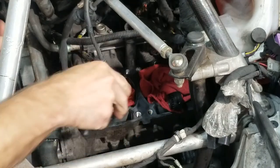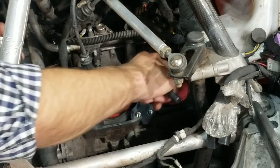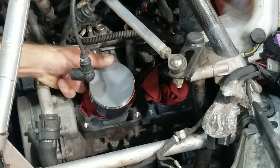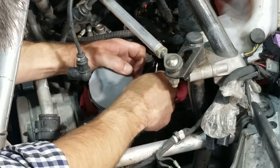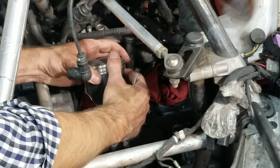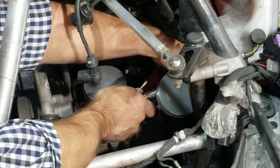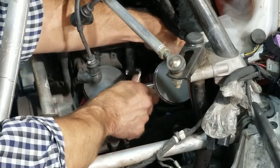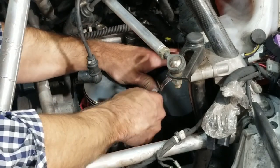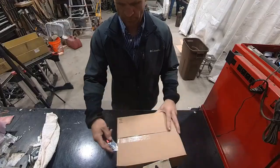A failure like this, though, is more likely to happen on one side or the other first. So if you don't get enough pressure to push your thumb off the top of the spark plug hole, that's your first indicator. Or if you can't quite tell if the compression between the two cylinders is different, you need to get out a compression gauge. And then if the difference between the two holes is sizable, then the odds are high that you've got an issue. I had 130. I had only about 90 on the failed side. In a way, it's remarkable that I had even that much. I guess that's because the bottom ring is still intact.